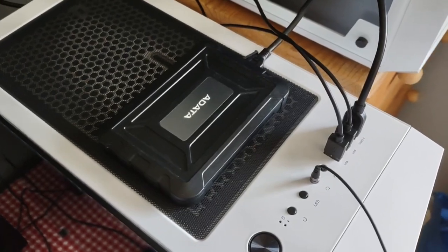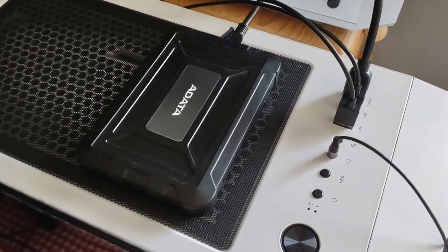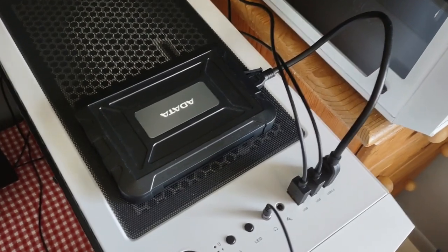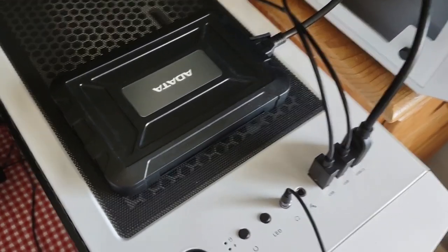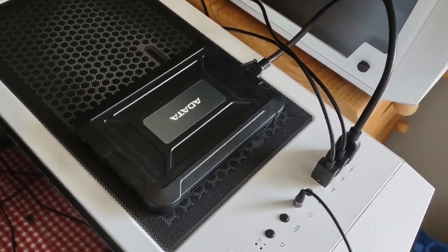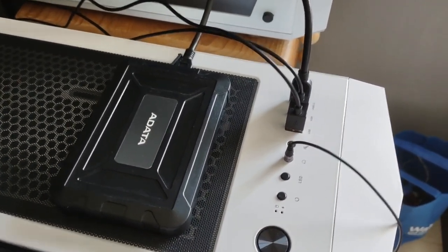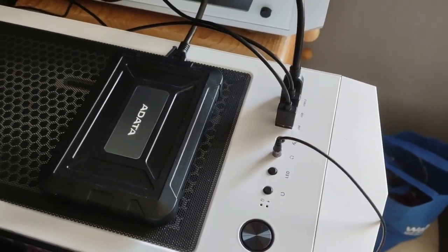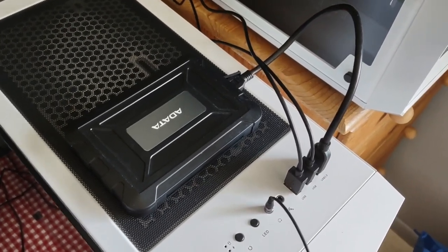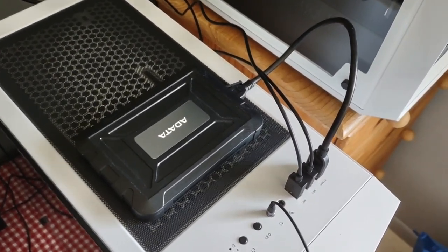For testing out our new system, we will be using an external SSD. It's a 512GB SSD with our Steam games on. Just because I don't want to bother installing them on this computer, because that just takes up way too much time. Now, this will make it a little bit slower than loading directly from the M.2 drive, and we'll see some moments of frame drops when we're loading new areas, but other than that, I think it's sufficient for testing, and it's just a way easier way of testing games than having to install them in every new system I build.